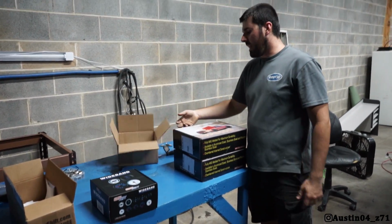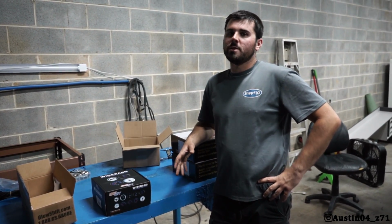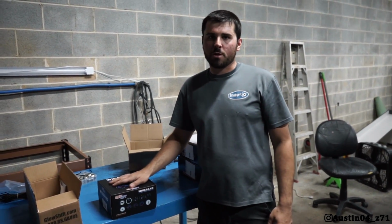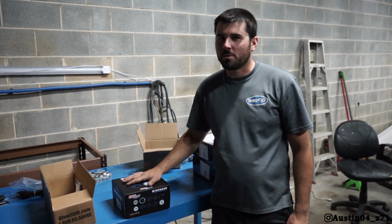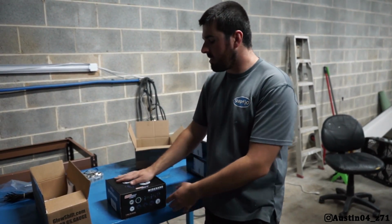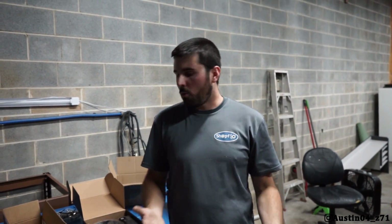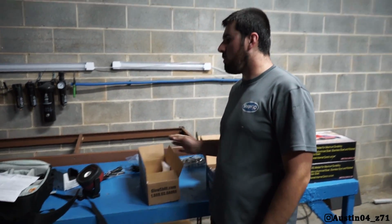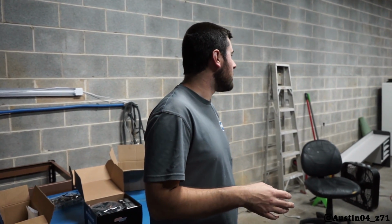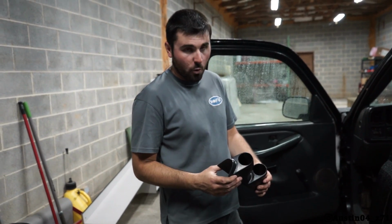Now, skid running on nitrous really needs a wideband so we can tell what the air-fuel ratio is on it to make sure that I don't blow it up. Also, for tuning purposes, and my tuner wanted me to get one in, there we go, got you a wideband. So what we're going to do, and we've got another gauge coming, it's on the way. We're going to put this wideband, and the other gauge that is coming is oil pressure. The one you guys have pointed out, the one on the cluster is busted, and also that one can tend to be a little bit inaccurate. So I wanted to get a good gauge on the pillar so that way we can tell the actual true oil pressure.